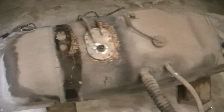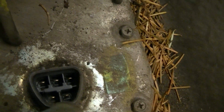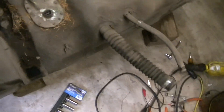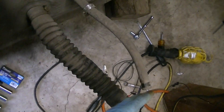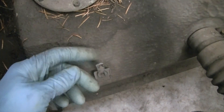Here's the fuel tank out. Here's what the plug looks like on a 2002 V8 Tundra. These two leads right here are the positive and negative; these three are for the fuel level and whatnot. To take the tank out it's pretty simple. The filler hose and vent hose — I recommend taking those off here, not here, because you have more room under the truck. And then there are three fuel lines; the clamps and lines come off pretty easy. You want to unplug this and detach the wire from here — it's just got some tape around it and you can pull it free.